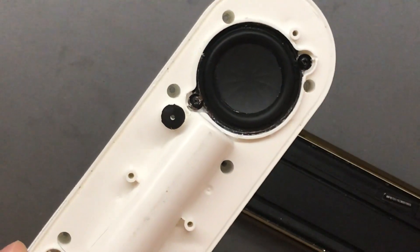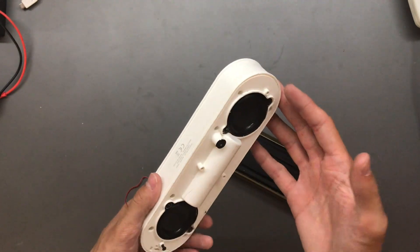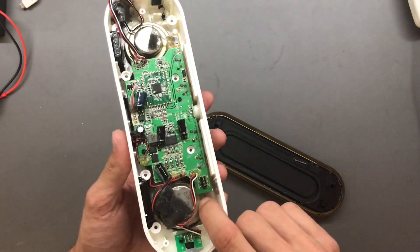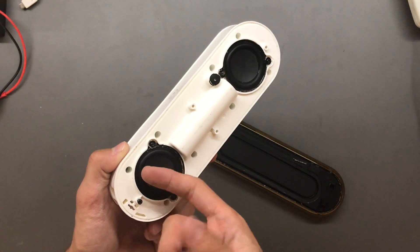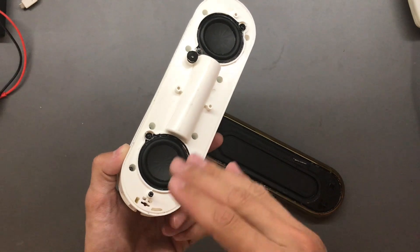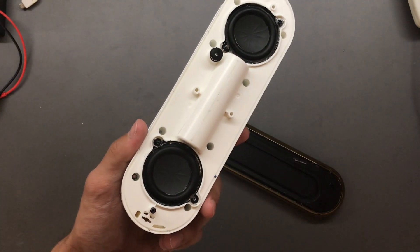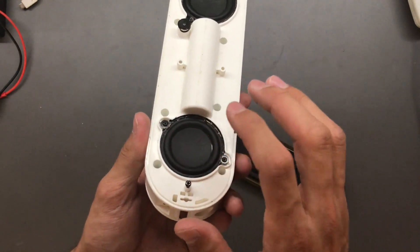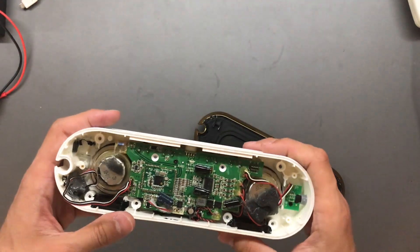It's very nicely engineered — I'd even say over-engineered. Sound-wise, it's decent for its size: pretty loud, though I like my audio a bit more bassy. When I first got it, one of the speakers was making a very annoying buzzing sound, like a piece of paper hitting the cone. I had to pop the speaker out and found one of the wires going to the coil was a bit too long and was hitting the membrane. I put a bit of silicone there and repositioned it, so that should be fine now.